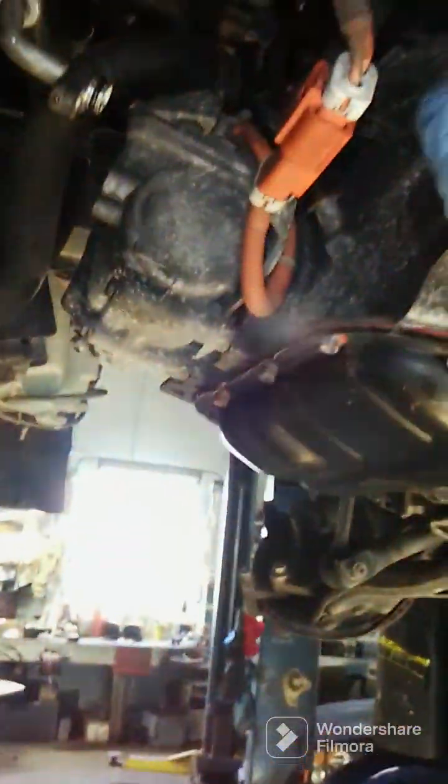So I got plenty of room up in here. I'm gonna go ahead and get these two exhaust bolts off, get my other two off, drop this exhaust down out of here. I got one other line up here to get off right there. Take that line off and then drop the exhaust off, so I'm done and can go up top and get the little stuff that's left up there. Now I got my exhaust down, got my two bolts from right there, two hangers, my two lines, all my other lines off here. I think everything is done at the bottom, AC lines off. I'm gonna go on up top and see what I got to do to get this thing dropped on down.